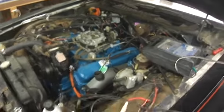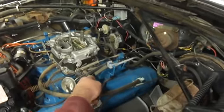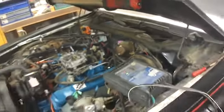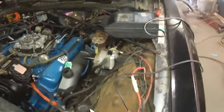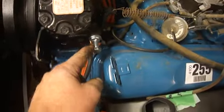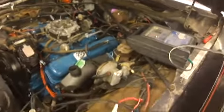It's alive! Yeah! Oh, there we go. Probably out of fuel by now anyway. A little hazy in the shop right now, even with the door open, but it runs. Had to dilly-dick with it for quite a while to get it to fire up. Part of my problem was, this is ugly because I don't have the right bolt, but I didn't have a good ground, so the starter was grounding essentially through the body.